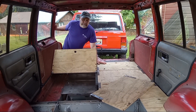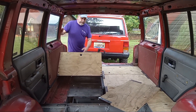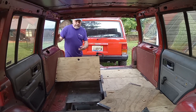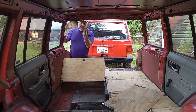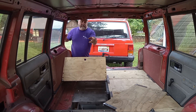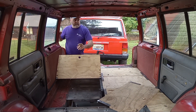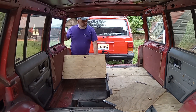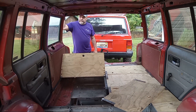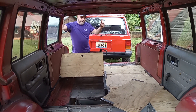That's how we're doing the turn and taillights. When you simplify it to that point, just run six leads all the way back using two old three-wire style drop cords — that gives you six wires. Use a ground, and then tie in the other ones you need. It really simplified everything, so I hope this will help you out on your project. Stay tuned for our next video.